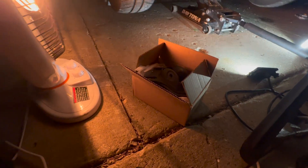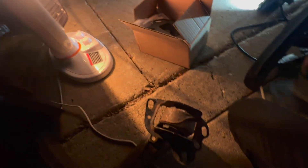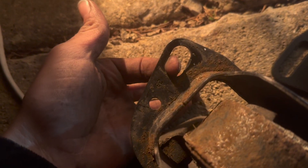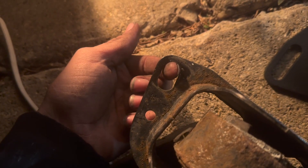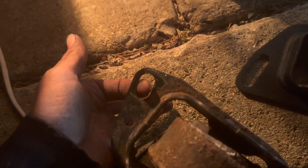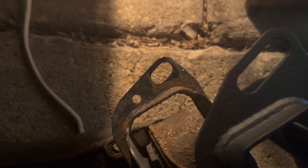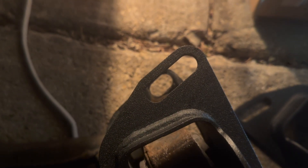Welcome to another video. In case you don't understand what I'm talking about in the title — toe correction plates — if you look at this plate, which is the toe plate, this is the adjustment for your alignment. The bolt sits in here and by sliding this piece back and forth you can adjust your toe. That's how they align your car at the alignment shop. This plate doesn't offer very much adjustment, but the new one is a lot more — looks like about double the adjustment.